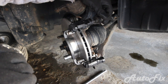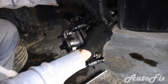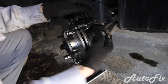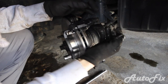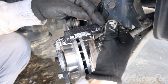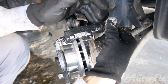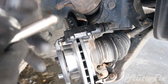Just twist the guide pin to make sure you get paste on all sides, then press it in. The boot should slide in. If it doesn't, take the lip of the boot off the guide pin, put the boot in to let all the air out, and then slide it back on. I ordered a new one because this old one won't stick in properly — this is just for video purposes, not permanent. Hopefully this lasts a couple days until the new one arrives. Do the bottom one the same way.